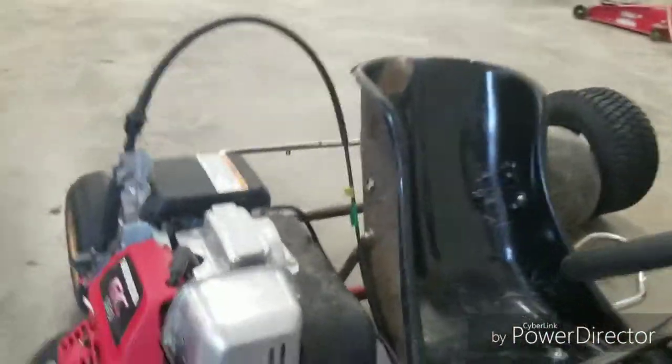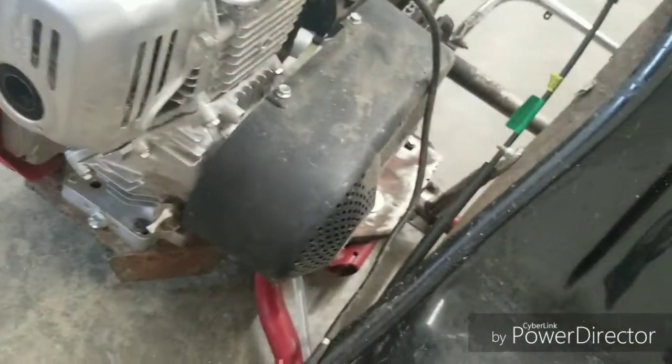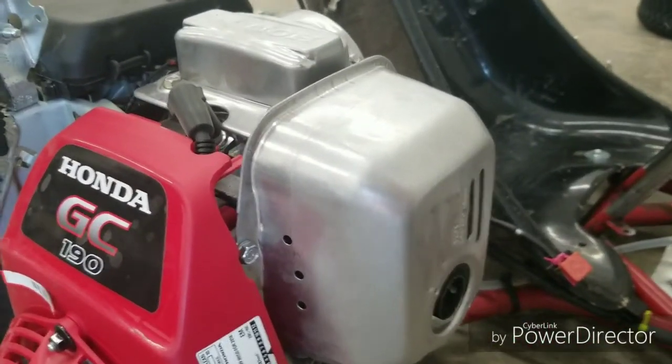And that's working pretty slick for this Honda motor. I had to do a pretty major offset from original because I ended up putting a Comet torque averter on it, which — if you take off this cover — is like any snowmobile clutch out there. It's pretty light duty; they rate it up to 10 horse and this is only like a 6 or 7 horse engine.